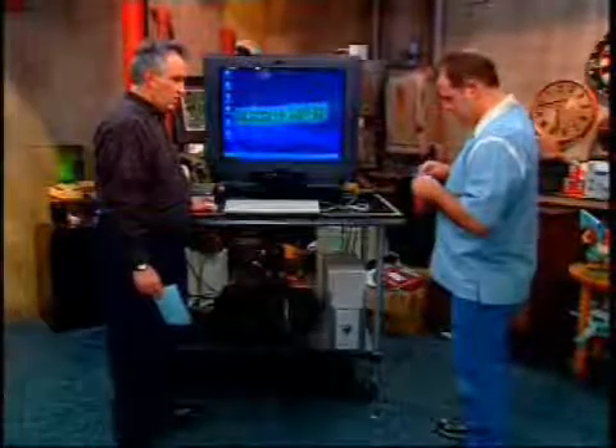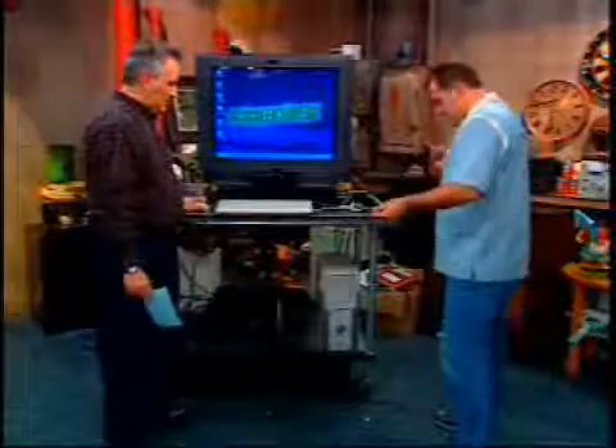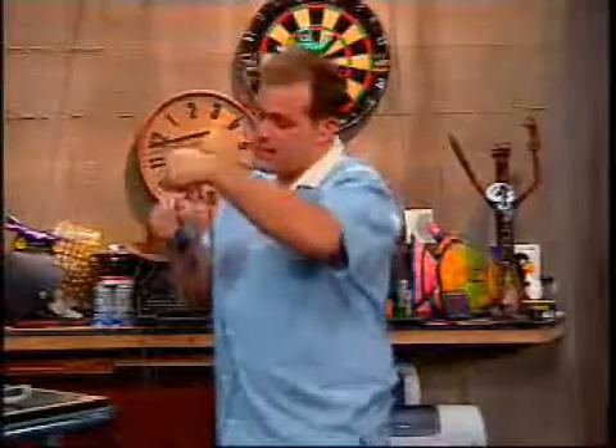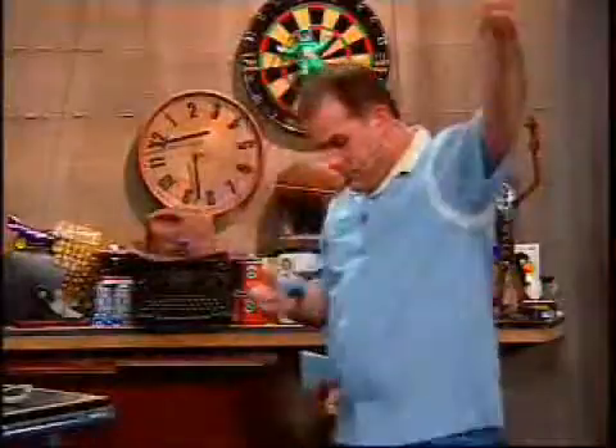So we're now up to about 12 feet with these cables — so we're still not past one cable length limit. Put another one in. Check this out — it actually says, even on the cable, there's a little tiny label here. Caution: do not exceed 10 feet of total cable distance on low-speed devices, 16 feet on high-speed devices. All right, so we're going to start NetMeeting.